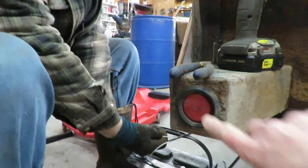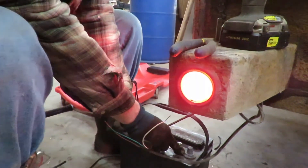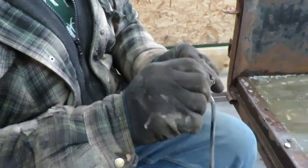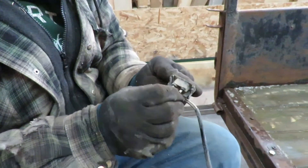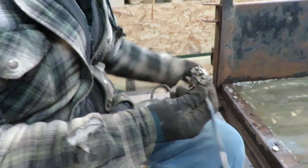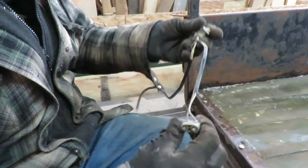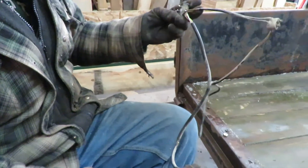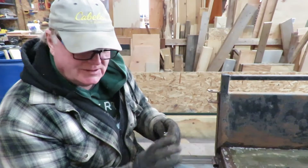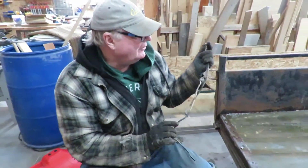So now you're testing this little light right here. Yep. That looks good too. I'm just going to clean up these connections here. They don't look too bad though. That light just plugs in and this was for the side marker light at the back. So we'll have to clean that up, plug it in and put some grease on it. And if it works, then we'll leave those lights in and just run new wires.